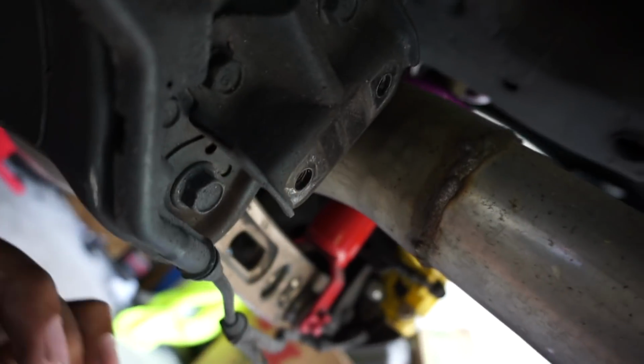So to remove my lower control arms, we have a bolt here, which I got on backwards, both there and right there, and then I drop this whole complete thing. Then I gotta remove all these brackets right here for the subframe brace, and same thing on this side as well. Hopefully I have something around here in the garage I can sit the thing on and get some time-lapse stuff going on. I'm pretty sure the next clip's gonna be a time-lapse.